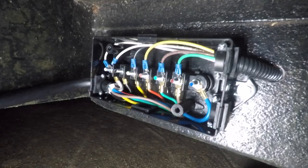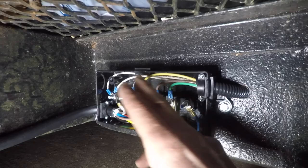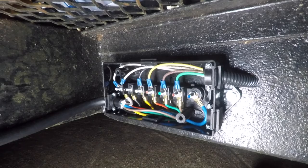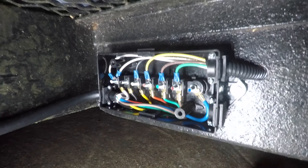So I was wrong about just matching the colors on the junction box with the wires. I did all the wiring correct as far as most American diagrams for what color does what. But on this junction box, they said screw that and made their own, apparently. The only two that were right is white is ground and blue is trailer brakes. But other than that, the black was 12 volt. Yellow is reverse, red is left blinker, green is running, and brown is right blinker and stop.